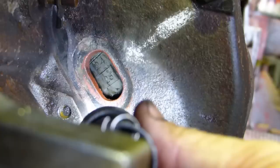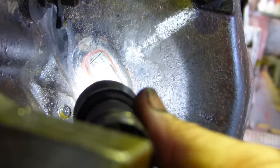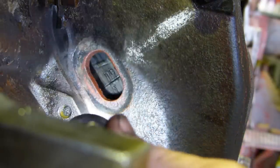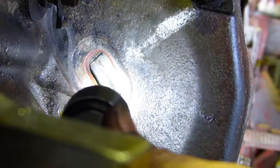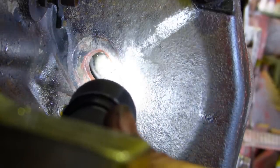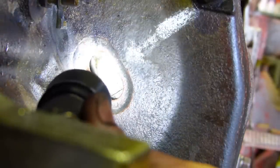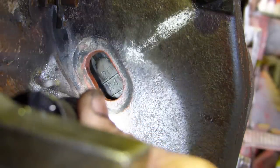You can just see 24, 28 and all that through this hole here. The engine doesn't fire right up on top dead centre. If you come around, there's TDC - that's your actual top dead centre - then when you come around you see 20, 24, 28, etc. Where my white arrow is in the middle there, that's where your timing mark is. You set that to 18 or 20 or 24 or whatever, so you know where to put the pump back.